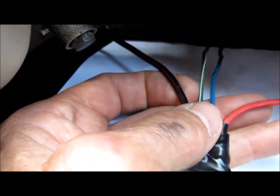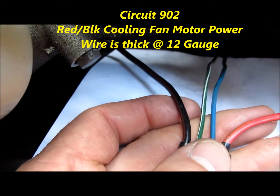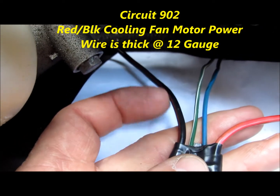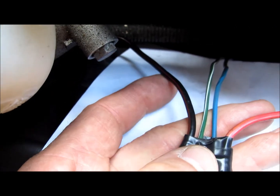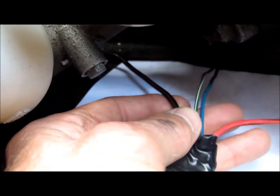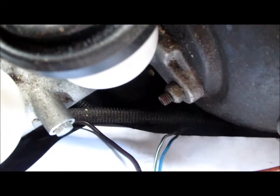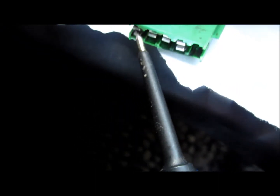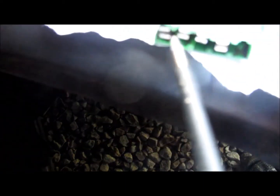This is the red and black wire, which is circuit 902. This is the one that the factory service manual stresses checking if your cooling fan isn't working. It's red and black — circuit 902 — and it goes straight over to the cooling fan motor. You can apply 12 volts to circuit 902 and the cooling fan should come on.